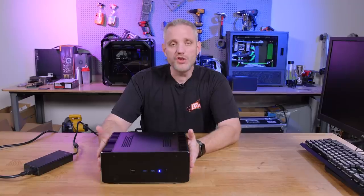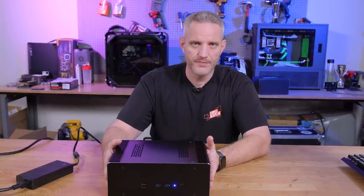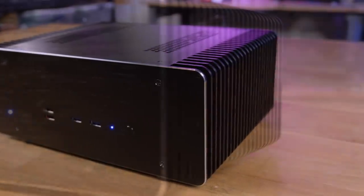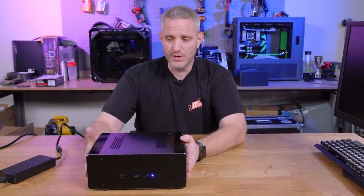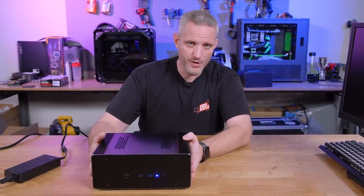There is also no front side audio on this. You could put a down-fire small form factor cooler in here and actively cool it, and it would look cool with these fins on the side — but that's a lot of effort for a case that's really designed to sit on a shelf and look great. If you're going to put it in any sort of AV rack, make sure it's ventilated. If you sit this near other hot components without adequate ventilation, or with a cabinet door that's closed, the temps you saw are going to be even higher.